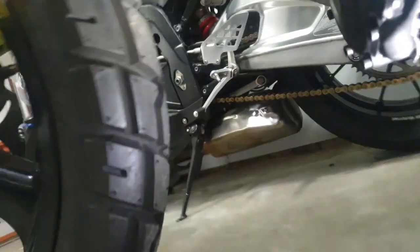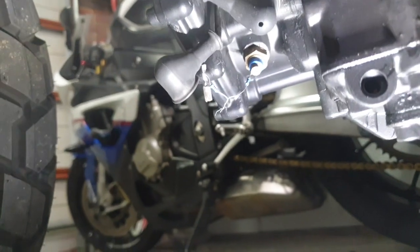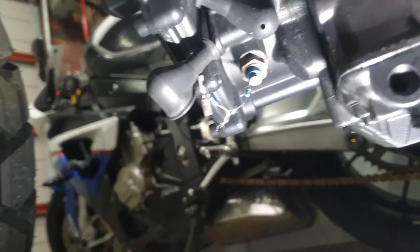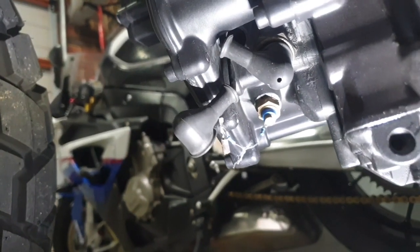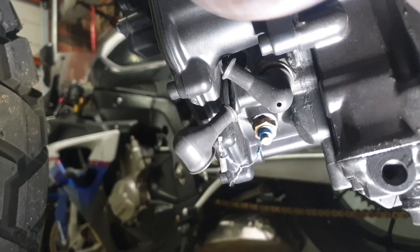It's dead on exact degrees — I'm not getting any more warning lights saying I'm overheating when I'm actually not. I'll show you virtually what I've done so you can see. At the moment I've just tacked it up for testing — you can see the 30 ohms hanging off the actual OEM sensor, and then I've got the 10 ohm in series with it back to the cable.